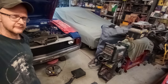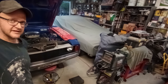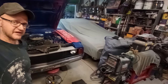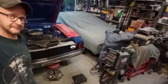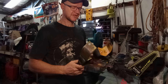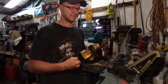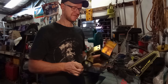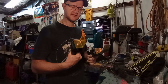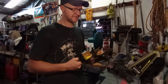So what I should do is find those exhaust hangers, get them out and modify them using the one exhaust hanger that I have with the car as a template. So here are the exhaust hangers to suit a sedan, which was all that was available on eBay, so that's what I ended up with. These are different to the station wagon hangers because the station wagon has a flat floor, whereas these tuck up behind the seat in the sedan floor pan, which is completely different.